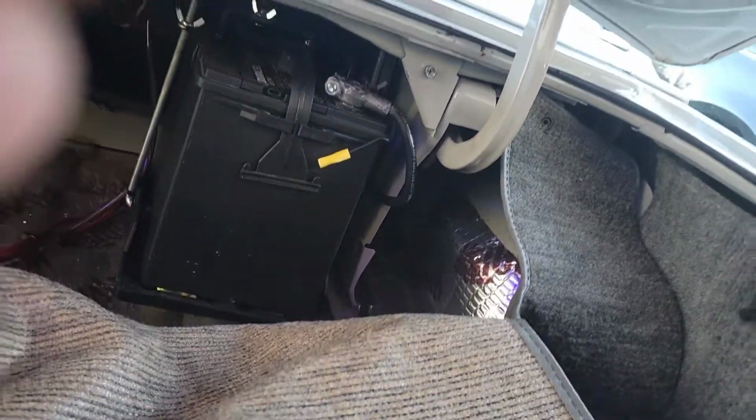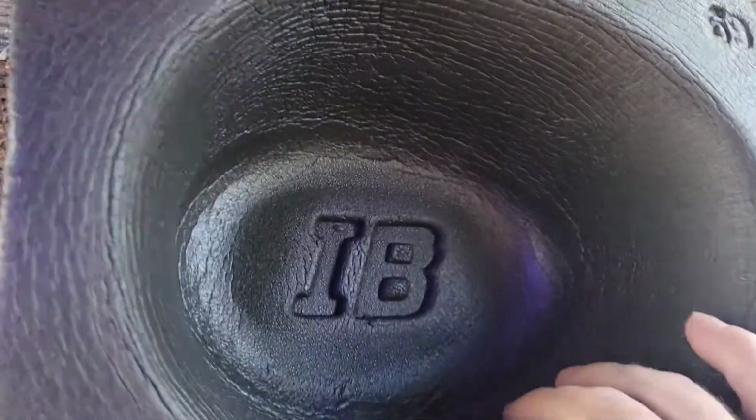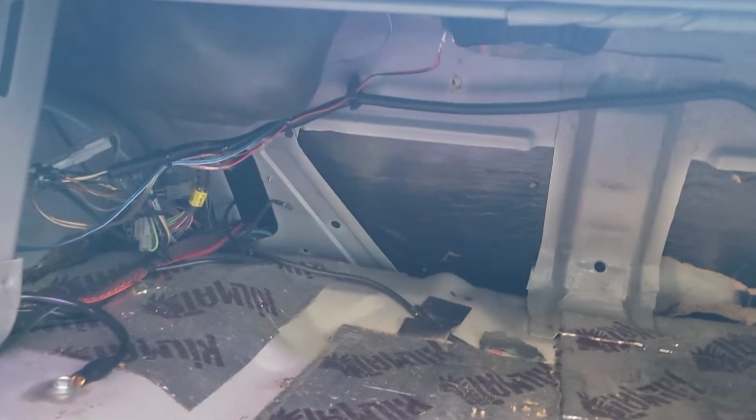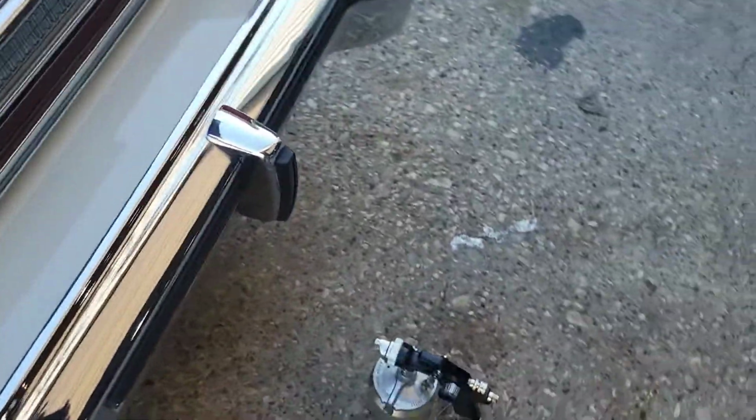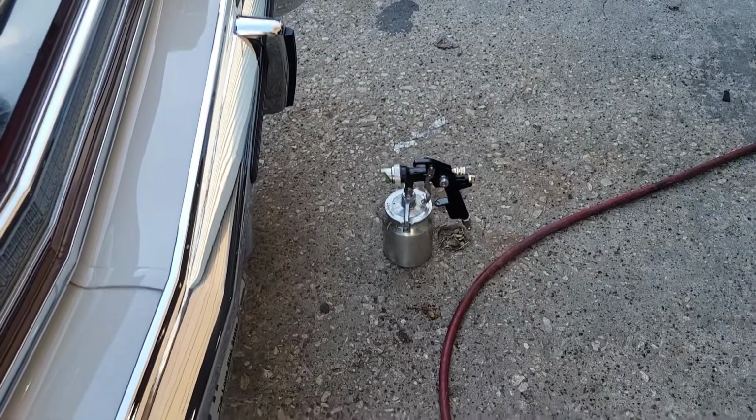These things right here. So these are gonna get glued and stuffed with stuffing. I'm gonna show you how that goes down. These are called baffles. They're gonna act like speaker boxes, and it'll also cut down on the excursion that's caused by having the 15-inch subs back here. So hang tight, I'll show you how it's done. We're going to take this glue gun right here, and we're going to shoot everything with glue, including the bottom of the speaker.